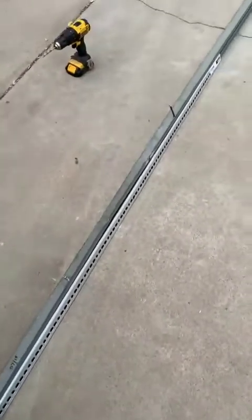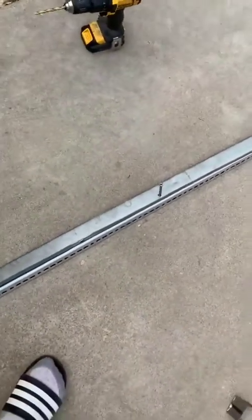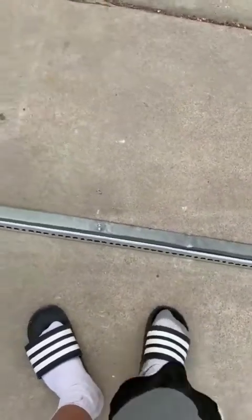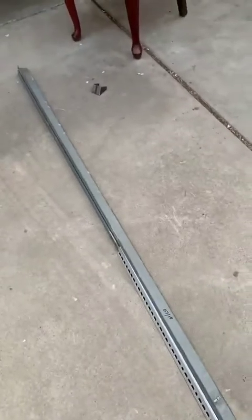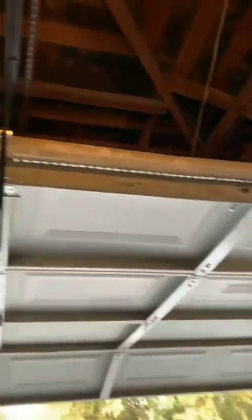So this is what I did. I put it in there and basically made it into a sandwich. I got the bolts and put two bolts on each side — the damage is right here, so I put one here and one over there and bolted it. I'm hoping this will give it enough strength when I put it back on the garage door opener — it should be able to hold it, support the weight, and work. I bolted it, put it all back together. You can see how I lined it up, bolted it all back in there. Came out great.